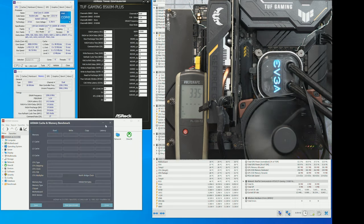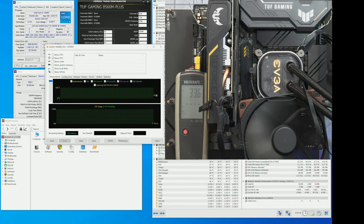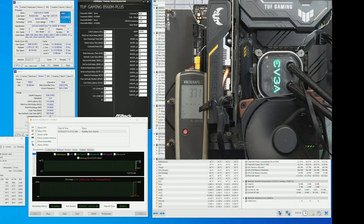I'm running a stability test with FPU — that usually generates a lot of heat — to see the behavior of the VRM section. The CPU goes really hot and I'm using an AIO, but sometimes it blocks. I don't really like this AIO. I'm going to check that later, but right now I just want to see if the VRM has any kind of issue.